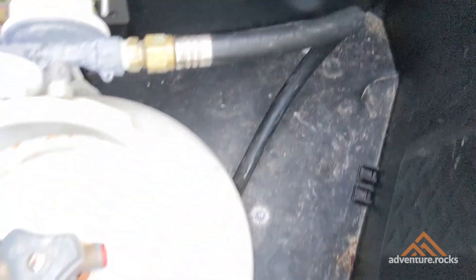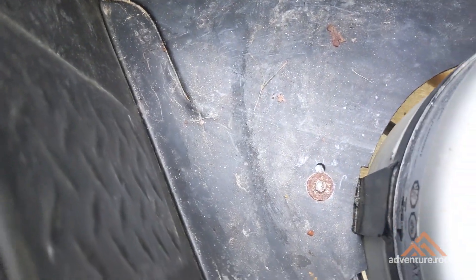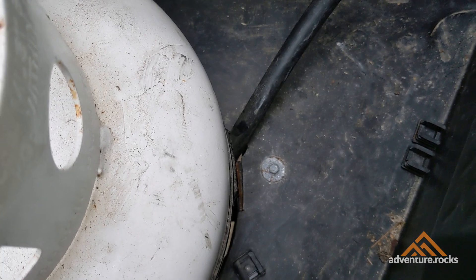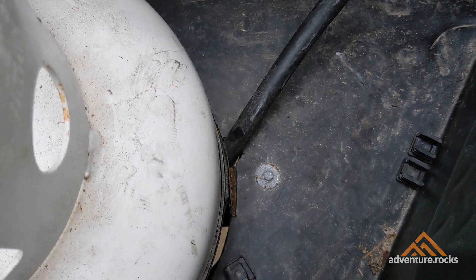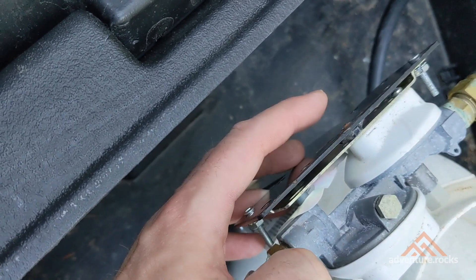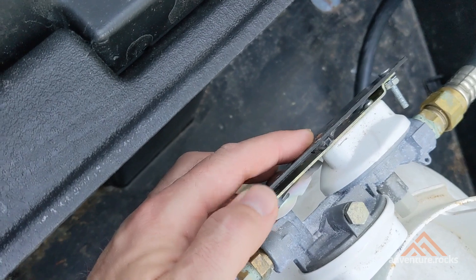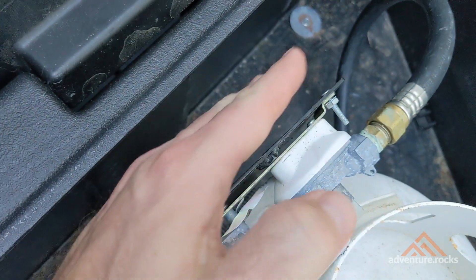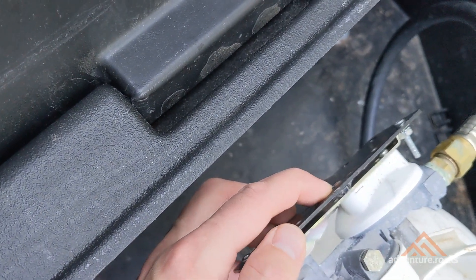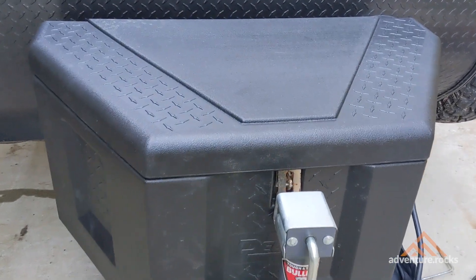You'll notice two other bolts on either side of the propane tank — those are for the propane tank mount. I went ahead and put those on top of the tongue storage box so I didn't have a bulge poking through the bottom. On the back of my unit, there was a bolt welded on to secure the previous propane cover that it came with, and for me it was in the way — it stuck out a good inch to inch and a half. I just took a reciprocating saw and nipped that little bolt right off, and that way I've got plenty of room to get things in and out.